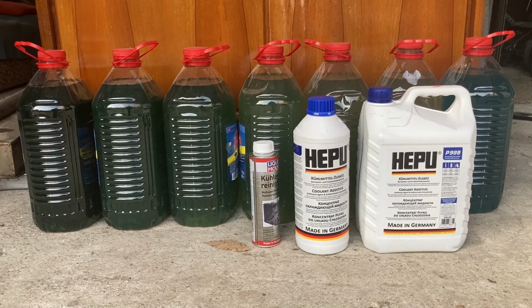Second to last mention, in case you're wondering why I did not use the same flush technique for the coolant as I used in the Corsa video, well, it's simply because there are two cooling system architectures in cars. The old style, which is similar to what the Kia has, where you have one radiator with a radiator cap, and then the coolant expansion tank, which is only connected by one hose and it's not pressurized. And for that one, you can't pour in new fluid and expect it to circulate through the engine before it drains. If we would have done that, whatever we would have poured in would have drained immediately at the bottom. Whereas in the case of the Corsa, it's on a newer cooling system architecture, where whatever coolant you put in the expansion tank circulates through the engine before it runs out of the radiator.